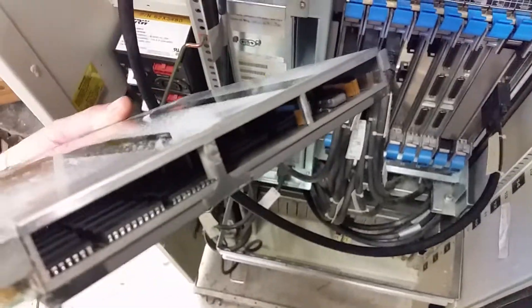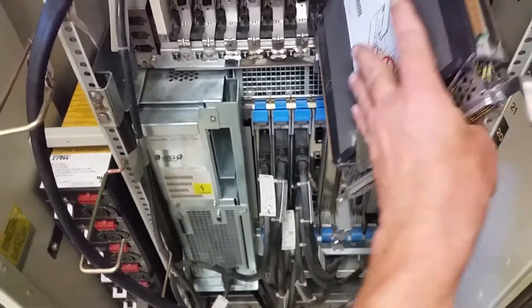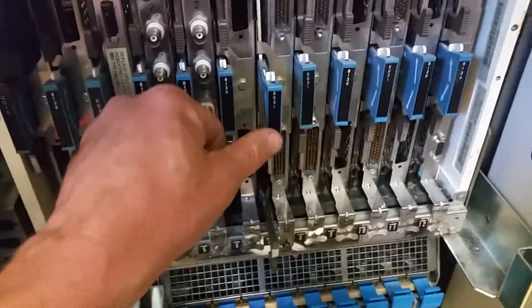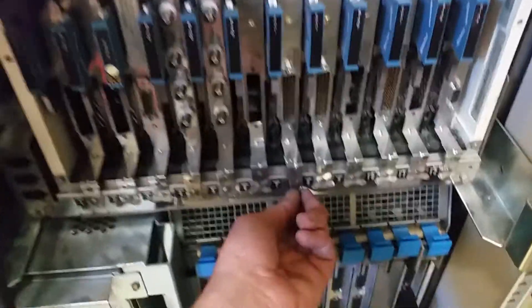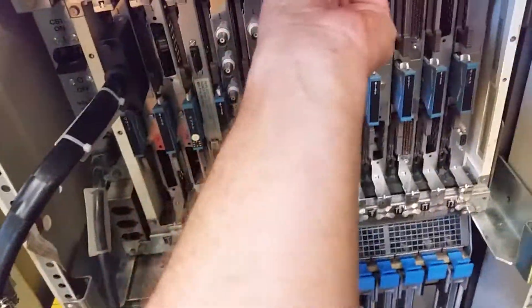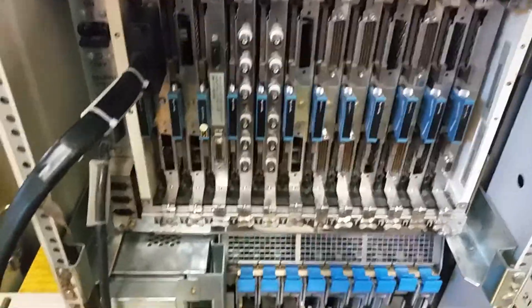It's a real pain to get into these cards, so all I can really show you is lots of DIP chips in there, some gate arrays — pretty standard construction. To get the thing back in: stick it in the guides and shove, and it clicks. You bend the card guides back up, they snap into position, give the wing nuts a quarter turn and it engages. Very weird, over-complicated system — but hey, that's IBM.